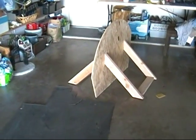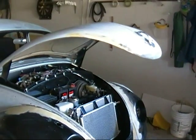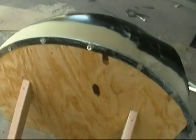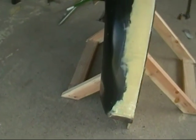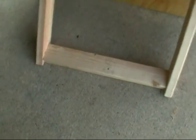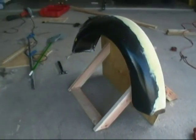I'll let this set up a little bit and then I'm going to pull this fender off, put it on my jig, and get ready to block it out and get it as close as possible. Here's the little stand I whipped together from my paper template - a few screws holding the fender into the plywood, a couple of legs. I balanced it out on the driveway so it doesn't move while I'm working on it. I marked the driveway so I know exactly where to put it back again.